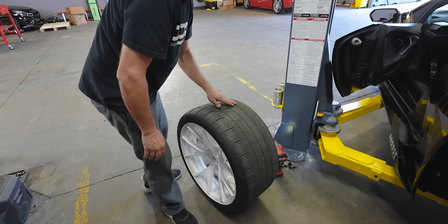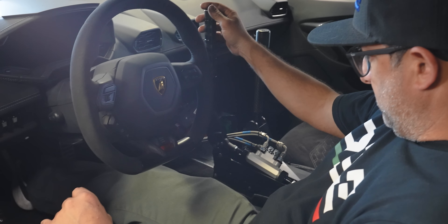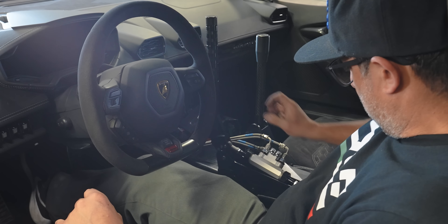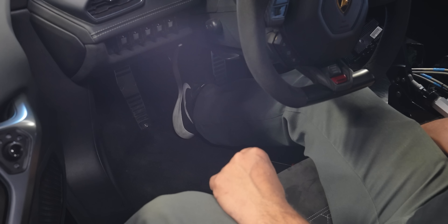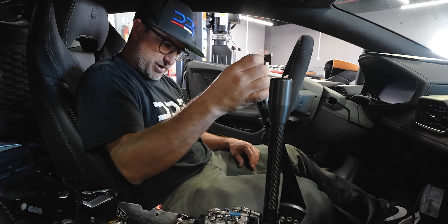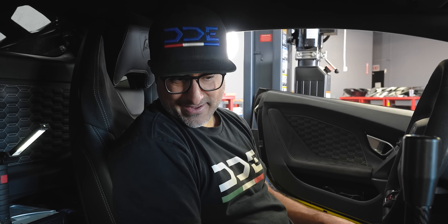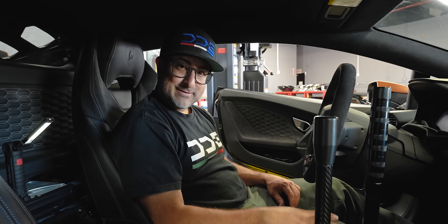All the fittings and lines are good to go. Now it's time to take the wheels off, bleed the master — hopefully there are no leaks. Time to bleed. We've got to get some fluid moving. There it is — we have pressure. That is awesome, feels really good. Brake pedal is nice and firm now. Shifter's in there. We need to put the wheels on, put it on the ground, make sure everything is good to go, and then start ripping this thing around.